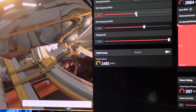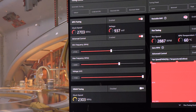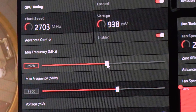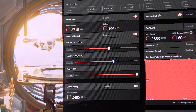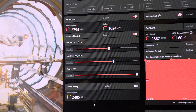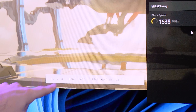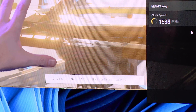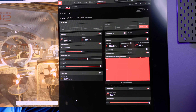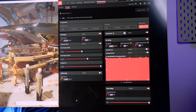That performance trade-off happens at a much lower frequency when the RT accelerators are involved. Let's set that to 33, and this to about 27. Look at the frequency — look at the VRAM there. We're losing VRAM clock at a lower frequency when RT is involved. If I push this up higher to 3000, look at that — clock speed down. I didn't even notice this before. The FPS is tanking and all over the place because it goes down as the VRAM clock goes down. In Heaven, it's not using the RT accelerators, so there's not as much power draw. Now that the RT accelerators are fired up, the core needs even more power, which is why at a lower frequency it's starting to pull from the RAM.